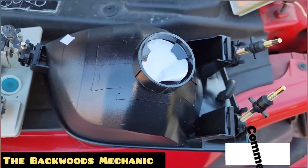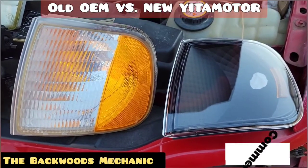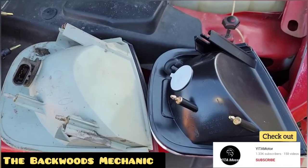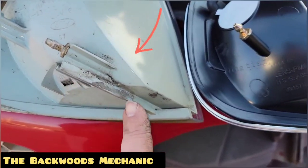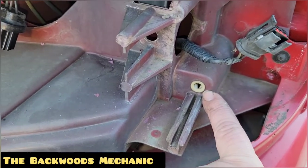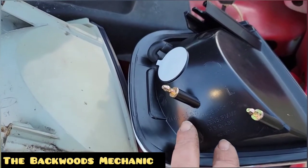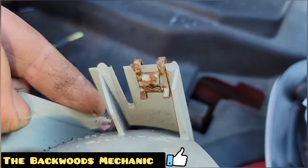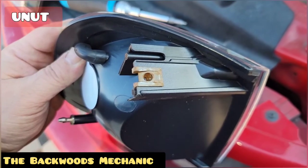It's got everything you need — you can adjust your beams up, down, left, and right. This will mount straight up to the truck without problems. As for the parking and turn signal lens, it matches up with the original as well — nice, crystal clear visibility. On the back side, you'll notice it's got this little guide right here that goes in this slot to help guide the pins into place. All you've got to do is take the clip off the original one, get in behind it, pry up, and it slides right off, then mount it up to the new one.